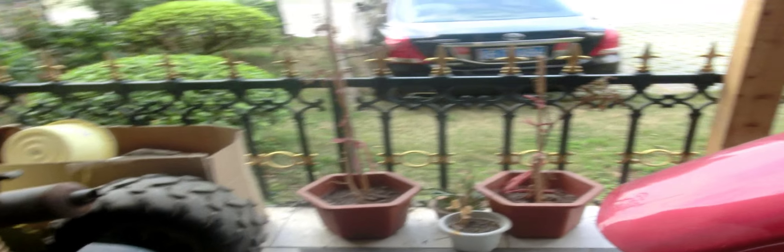So there we have disc brakes. Now what about drum brakes? This four-wheeler has a single disc on the back — the caliper is hidden underneath, connected to the axle, stopping both rear wheels. The front has drum brakes. The wheels are missing but I'll show you one in a minute. Here is a drum brake, and there's another one over there.